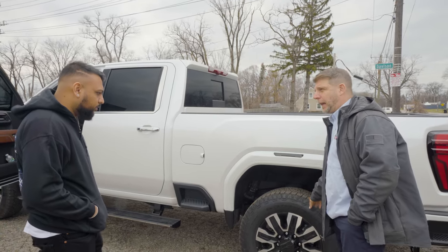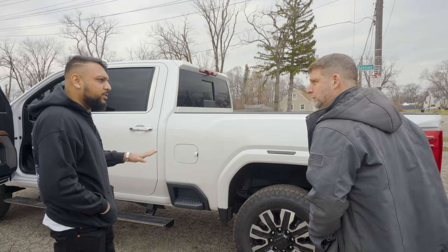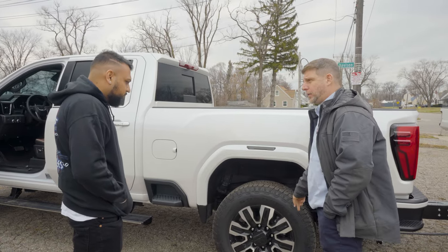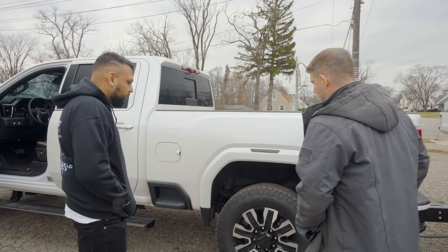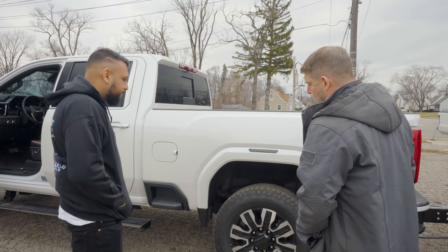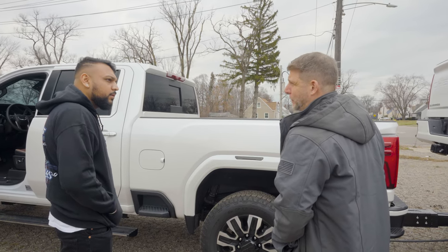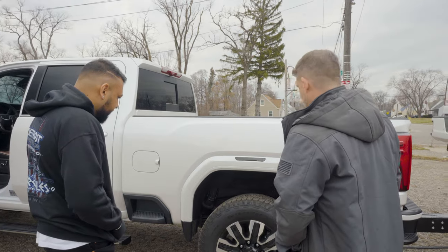I think it's 10-ply versus 12-ply. So 12-ply is load F. Is there a difference in tire pressure or whatever the standard is on the truck? Well, on here, you're gonna go by what the tire rating is. You know what I mean? Because you're gonna put a load on. So these are gonna wear out eventually, and when you do replace them, look, you know, load F. If you gotta find load E, don't feel bad, but try to put the better tire. You know what I mean?